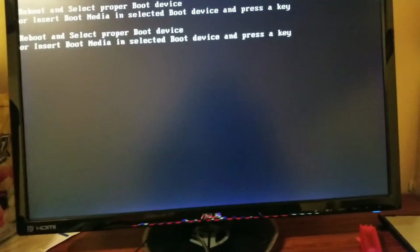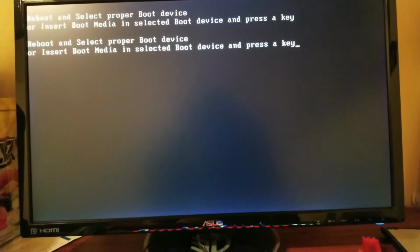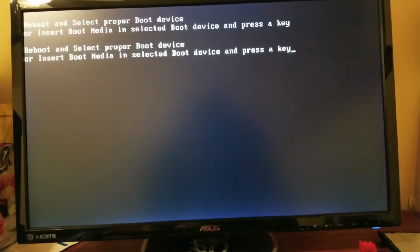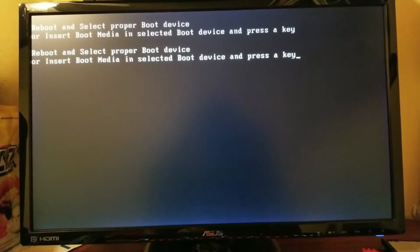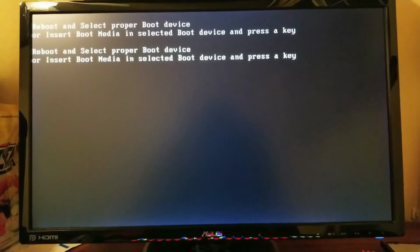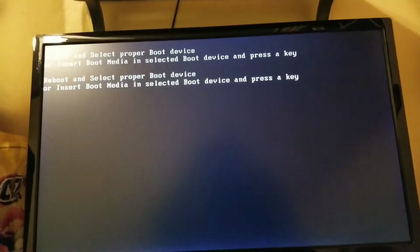So my brother got also this wireless card. So basically Windows 10, I created a bootable USB. You can create that actually with another computer. You just go to Google and search Windows 10 USB drive creator. Microsoft actually now, they made it so it's free to create a bootable USB with Windows 10 on it. You just need to have access to a computer with a Windows 10 license already there, and they'll let you download that.